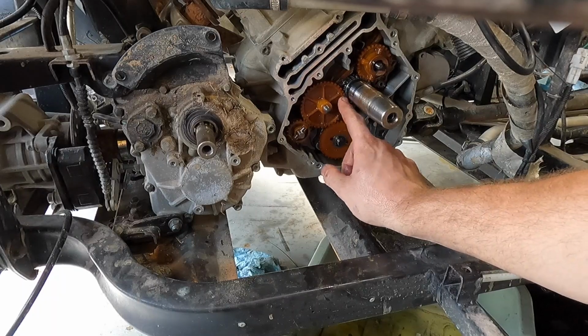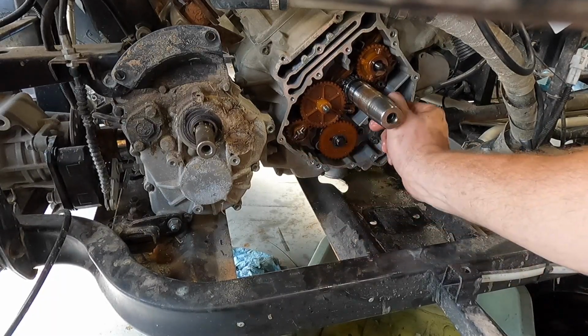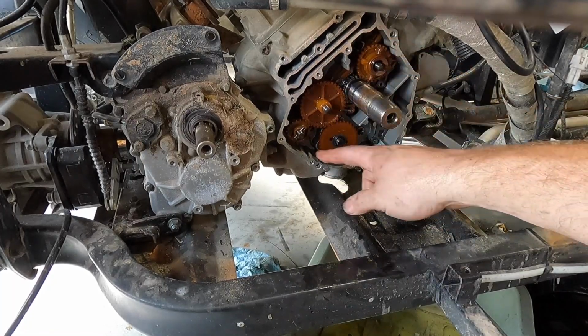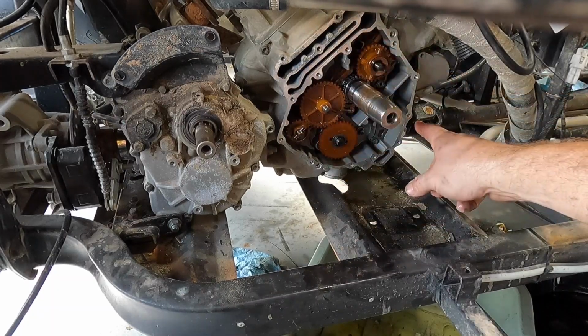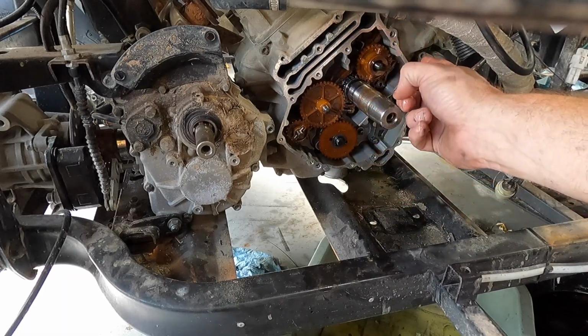So got to pass the crank now on the oil pump, on the water pump gear. Everything is solid in place. Now we'll go ahead and clean up the side case cover here a little bit, and we'll go ahead and rebolt everything back in the same way we took all the bolts out, which you guys don't need to see. And all those will be torqued to 10 to 12 Newton meters.